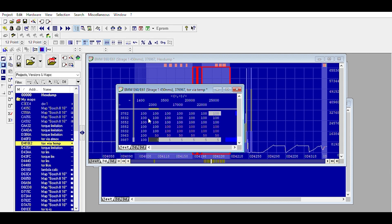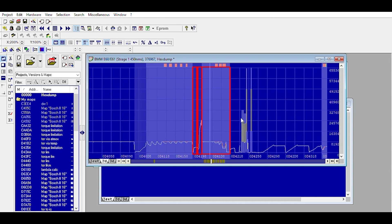You kind of don't want to touch it when it drops that much. But if we look here — here's 40 degrees — what we're doing is pretty much allowing power to maintain. I only changed that by 10, and all these bits here we change to 100. But this is actually another torque limiter technically, based off atmospheric pressure and temperature.